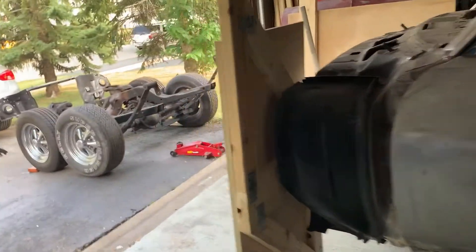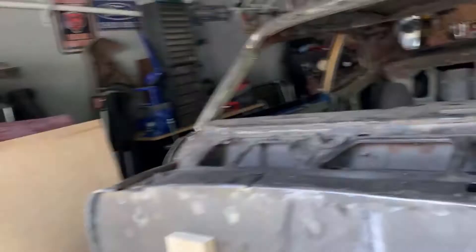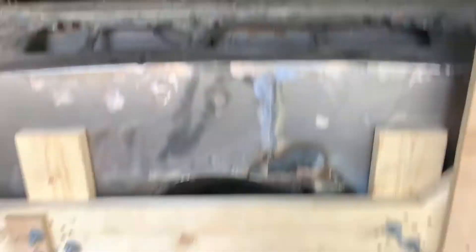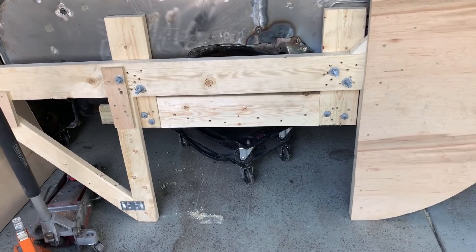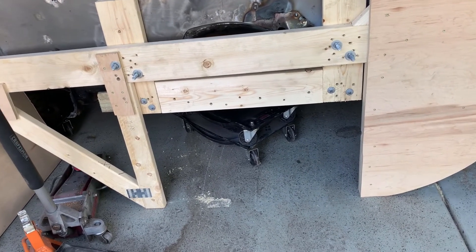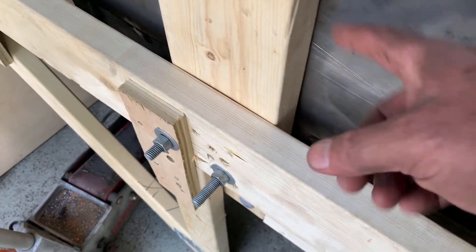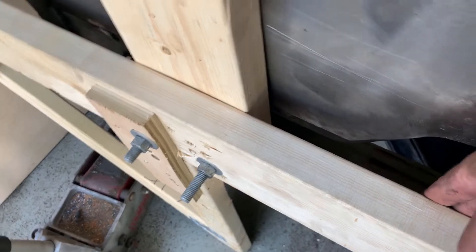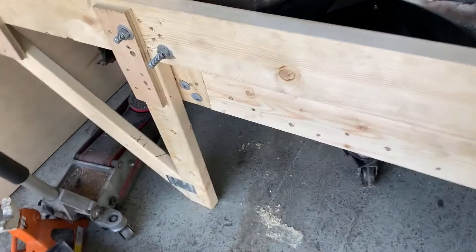Now let's get to the front of the jig. This one was a lot more modified than the rear. The front hookups are very different on a 71F body, so the instructions got me close but I had to do a lot of modifications. As you can see here, I split the carriage bolts around — I had to take this all apart. You can see it's leaning right up against the firewall. It is sturdy; it will support the weight of the car, and I'm confident when we tip it over we'll be fine.